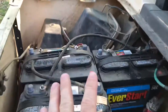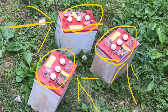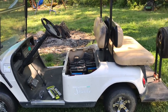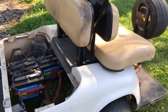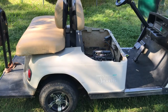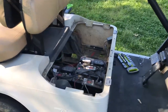It was a super simple swap, took about 30 minutes. Why did I do the swap? These batteries need water in the three holes, and the previous owner did not put water in them. The golf cart is not new by any means — somewhere on it it says 2000, so it's 21 years old. Those batteries were from 2014, so they were six years old — I was told they were only one year old.